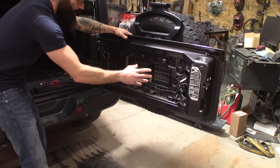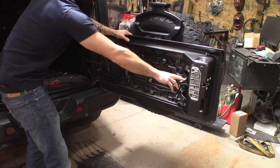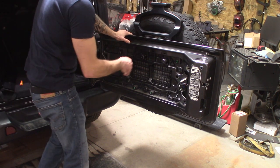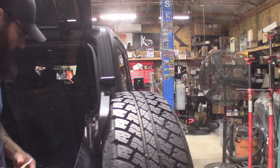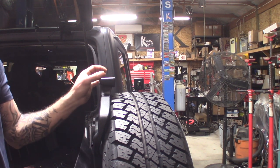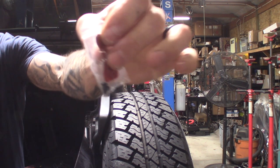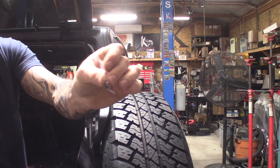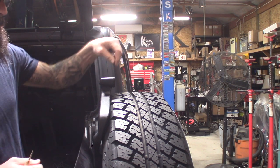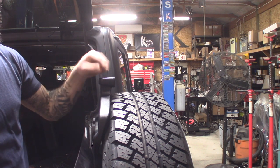You want to find a good penetration point to get to the outside. You can use one of the OEM lines that your brake light comes through, or make your own — just make sure it's sealed from weather. We'll run our wires up to that brake light. Once you get the wire run up, go ahead and set the camera where you want it. We usually use the third brake light section — you can put it right on top. The kit comes with adhesive tape and some tiny screws. I'd use them together, or use longer screws or bolts. Just make sure you don't hit the light — it's very shallow, so you may need to pop it out, measure, cut, and drill as needed.